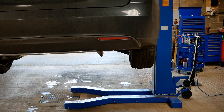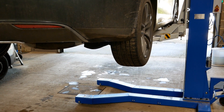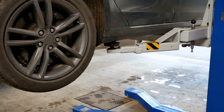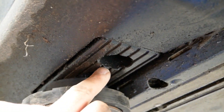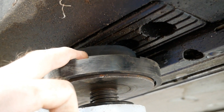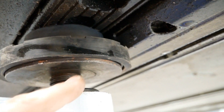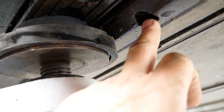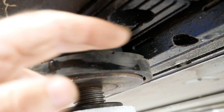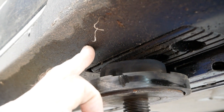I don't think I'd want to be doing any heavy suspension work or banging around standing underneath, but I've got props that I would use if I was working underneath. In this case I'm going to lower it because I'm only working on the wheels and I'm not going to be underneath the vehicle anyway. Looking underneath here we can see the jacking point on the Model S — it's this panel here, with three holes, and we're using the back hole. You can see why you need to use the spacer, because your jacking pad would be touching the battery pack otherwise.